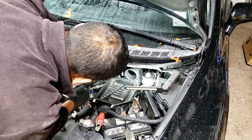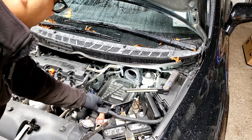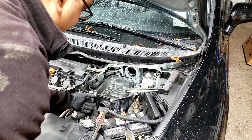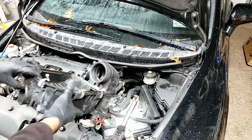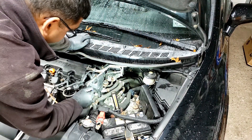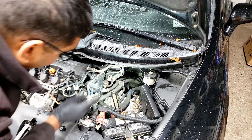Use clip pliers to take that off — there's no clamp for this, it's just an air duct connecting from the bottom. There are coolant lines: this one, this one, and this one. Usually you have to take these off, but what I'm planning on doing is taking this hose out right here, loosening the throttle body bolts, moving the throttle body, and then cleaning it and putting it back.